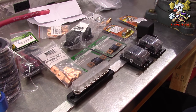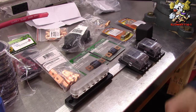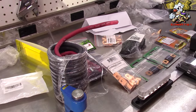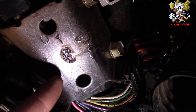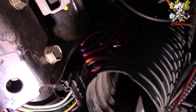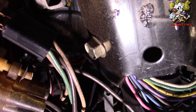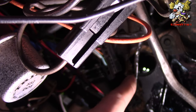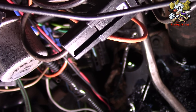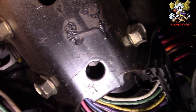I'm going to put this underneath the column of the car — there's a bracket there. I'm going to cut this aluminum stock, drill a hole, mount it to the bracket, then mount it back on the car. Before you do this, make sure you have a hole in the firewall to bring the cables through. We have a hole right there from the clutch assembly we took out — I'm going to put a grommet in there. Make sure you have a step drill or something to make a big hole with a grommet. I'm going to go ahead and take this bracket off.